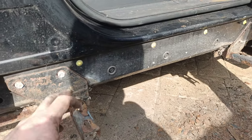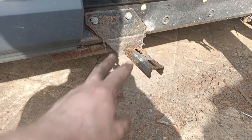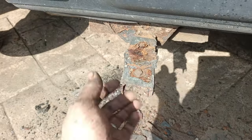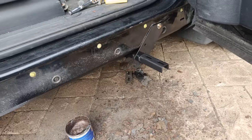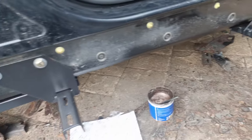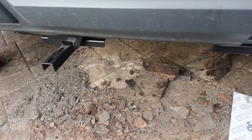The two bolts that held the step on the middle bracket, they just sheared off. The ones at the front I had to drill - you can just about make out I missed where the hole was but they weren't coming off. And the back one, the bolts are still on but the actual surrounding material had rusted away. So that was fun. However all the brackets are now on. I had broken bolts with the head snapping off, had to drill out a couple as well. More work on this side than there was on the other, despite there being less corrosion.